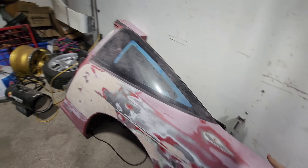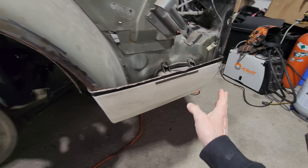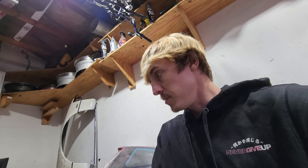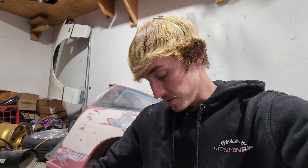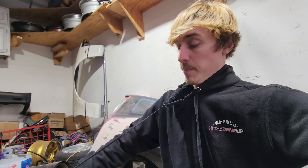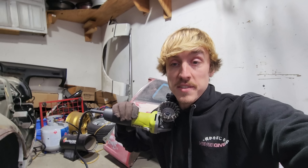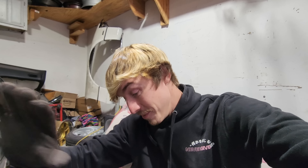Since we determined we cannot use this quarter panel and I got rid of the other one, we can now finish removing the rest of the quarter panel on the car. I also need to get the rest of this wheel well off - might as well knock that out. I can't really see the spot welds here or on the bottom, so I'm going to use the wire wheel to try and expose some of that metal. A good rule of thumb - if you're going to use any rotational tool, especially a wire wheel, you want to tuck anything loose away. My friend was using a wire wheel and when it caught his string, it went all the way up to his neck - that could have been really bad. The strings are stitched into the hood, so we'll just tuck these in.